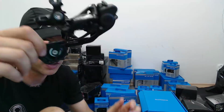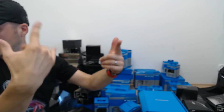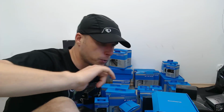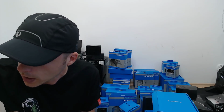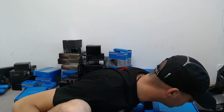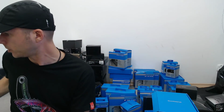And then I took the Deore derailleur and the XTR derailleur, which is somewhere here. I've got so many boxes right now. There was no difference in how they operate. The clutch from the outside looks different on the XTR and Deore, but the operation is the same. You need to apply the same force in order to move the cage. That means Deore should be as stable as XTR. It will just be heavier. It won't be 11-speed. Okay, I don't know where I put it. Sorry. But it should work.